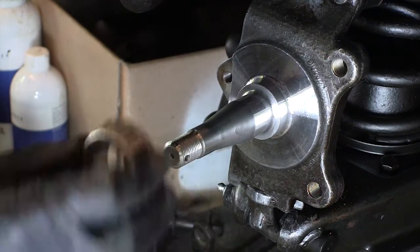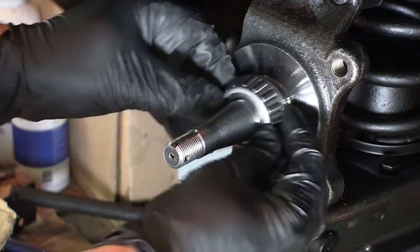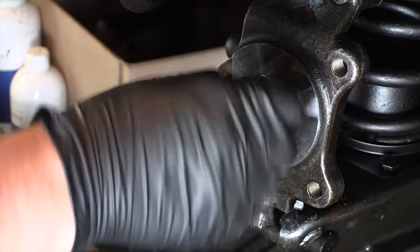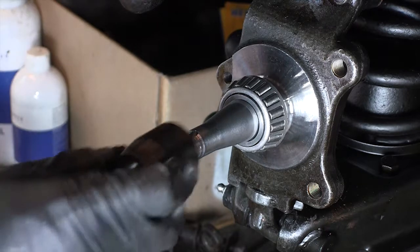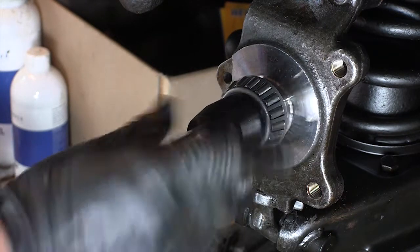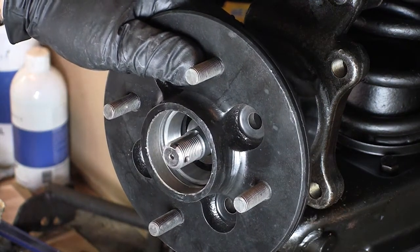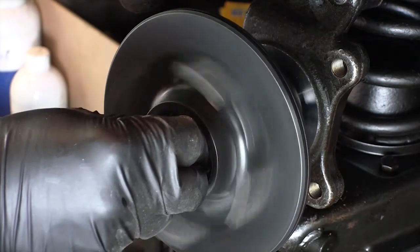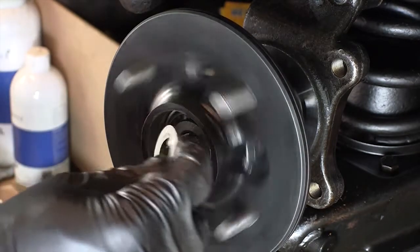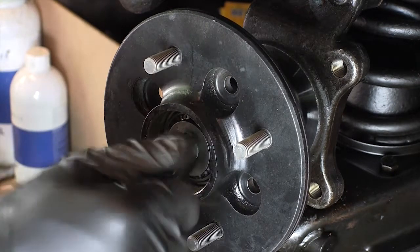You can see it's got a nice shiny finish on it now, so hopefully this bearing should now go on. You can hear a little knock — that's touching the back. I'm not assembling finally until I know what the end float is, so this is going to be the first stage. Inner bearing on, spacer with its spacer inner race, and the hub goes on. Then we put in the outer bearing. I've just put a tiny bit of light oil on the bearings just to do this. And then we're going to tighten this nut up until that bearing drags.